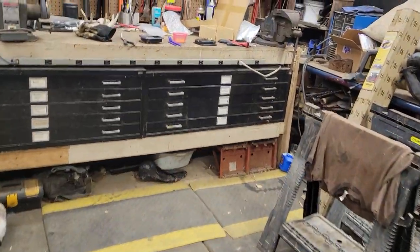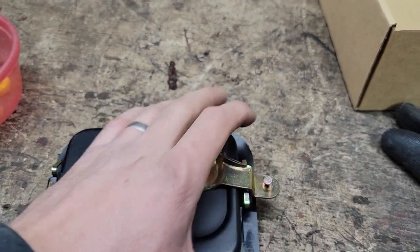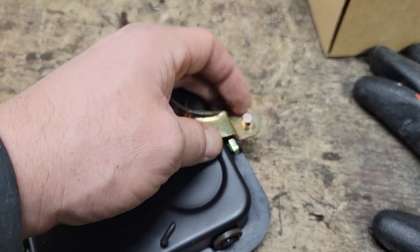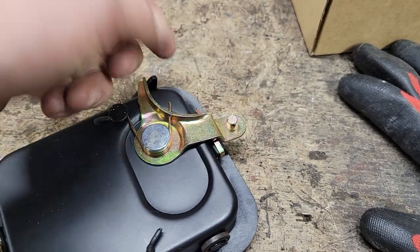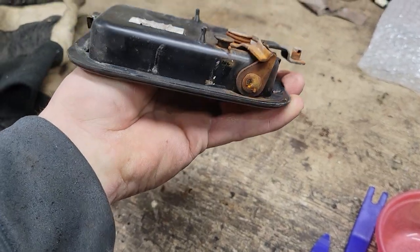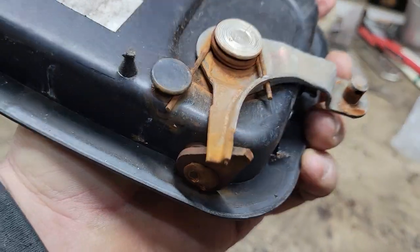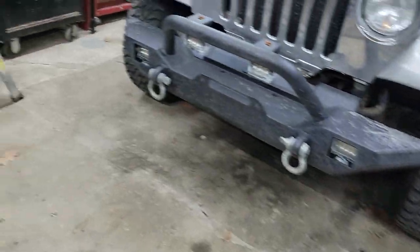The actual lock mechanism is a rod that comes up and has a hole in it that fits over a peg. There's a little spring washer in the back that keeps some tension on that so it doesn't rattle, and there's a cotter pin on the front like a hair clip that you can pop loose. I reached in with a screwdriver and was able to turn it to the side and then got in underneath it and just pushed it out. A little bit fiddly, a little bit tedious. There's the backside of the old one — a little bit rusty, a little bit worn. This one coincidentally was a little bit hard to open before, like it almost didn't have enough throw, and I imagine that's because of some of the wear in these parts.